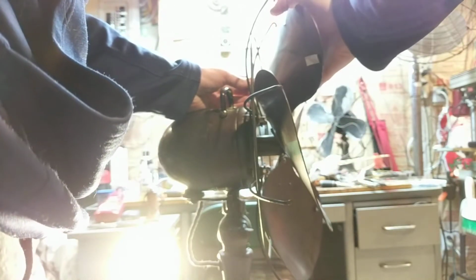So what you'll do is you'll bend the pitch a little forward. Now if you see them, they're all hitting except one. Figure out which one. Now it's this one, so now you have to push it back a little bit. It doesn't take a lot of force. And now, see, they're all hitting.